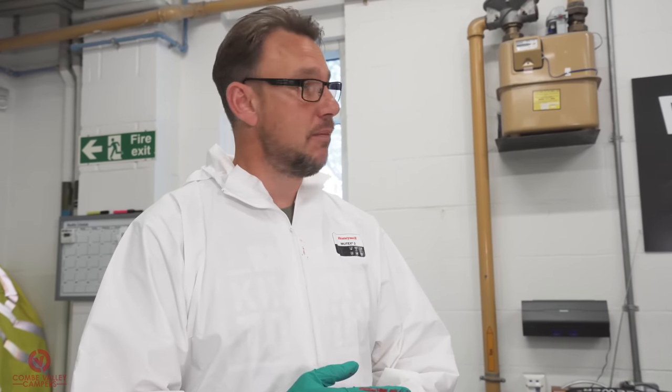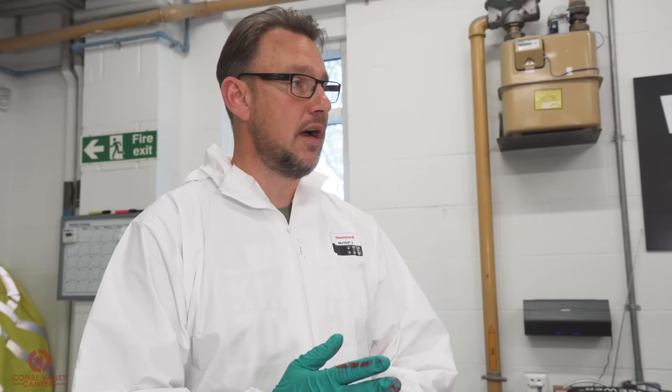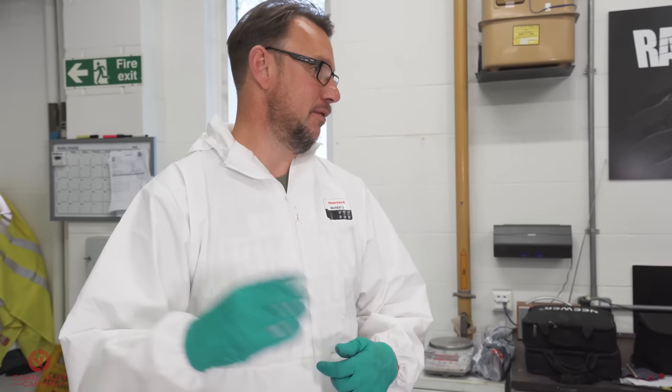Base coats, because you may be having metallics in there, they're a little bit thinner in consistency, so that's when you may need your 10% maximum in there. Again, you can tint with any tint as long as it's a solvent-borne system. So you go down to your local automotive distributor, and they can mix up your requirement. If you've got your car colour code, for example, you say, I need a flame red in X, Y, and Z, need 200 ml, they'll make it up, you bring it back, and then you tint your tintable Raptor that way. Perfect. And then on top of that, you harden, and away you go.